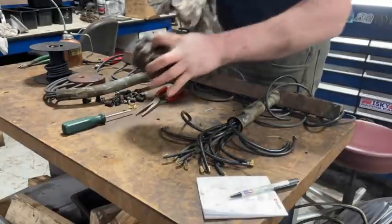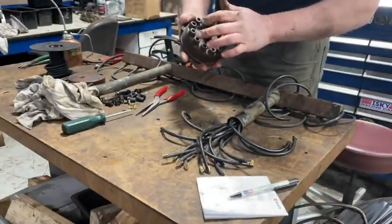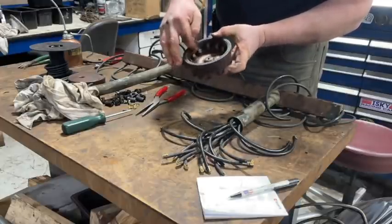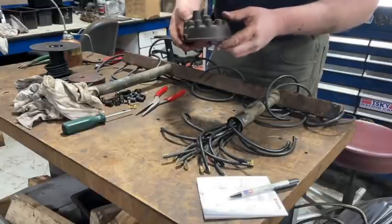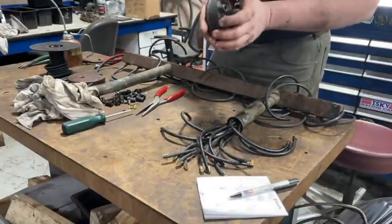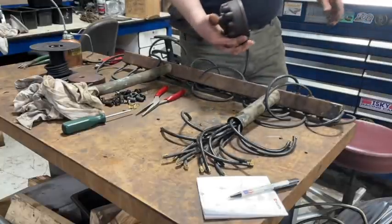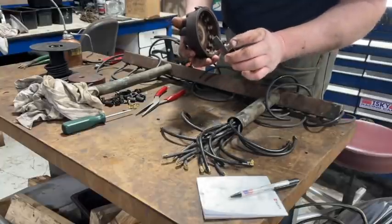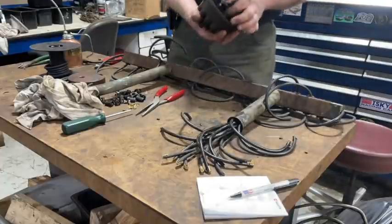In the meantime, I bead blasted the cap here, went through and cleaned all these connections, and I cleaned the inside here. I spot bead blasted all these contacts. You cannot get one of these, so if you have an antique fire truck and you have this on there, be very careful. Do not lose your distributor cap or break it or damage it, and especially the rotor, which is right here. You don't want to lose this because you can't get these at Napa. So anyway,